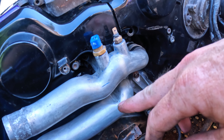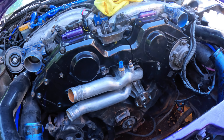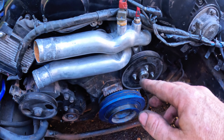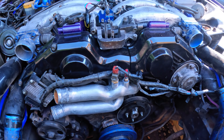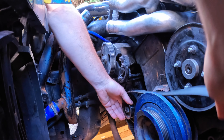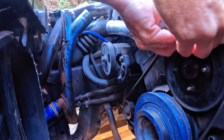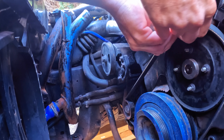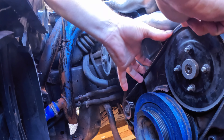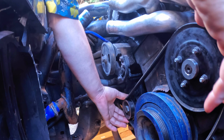I've got to come back and tighten up the two Allen bolts and that one down there, then leave it 24 hours before any coolant goes in. I've gone ahead and reinstalled the crank pulley and that pulley there - the bolts will need to come out again to put the fan on. I've also put the wiring loom and the PTU back in. Now I'm going to refit the alternator belt - you can see it goes around there and around the bottom of that pulley.